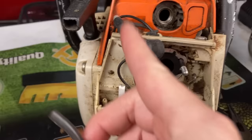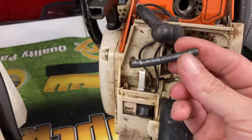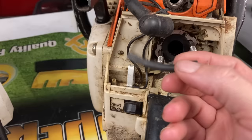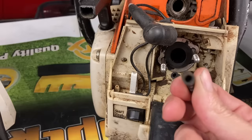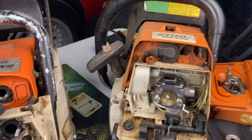There is another design I don't have here — it had more of a rounded base with a plastic cap that went over a filter to hold it on. Over time these would leak a little bit, and those other ones would leak a little bit too. The EPA probably intervened and Stihl had to change their design. So they went from having this simple 50-cent piece of a tank vent to something that's about eight or nine bucks now.